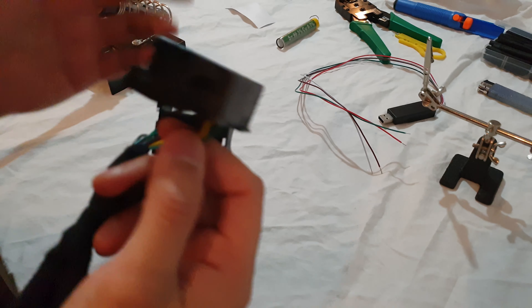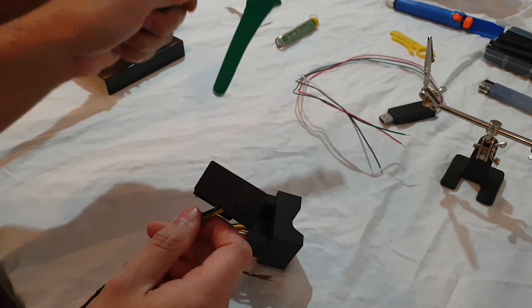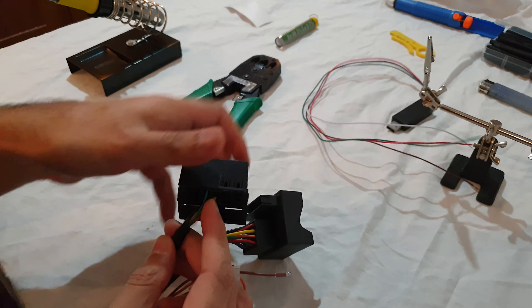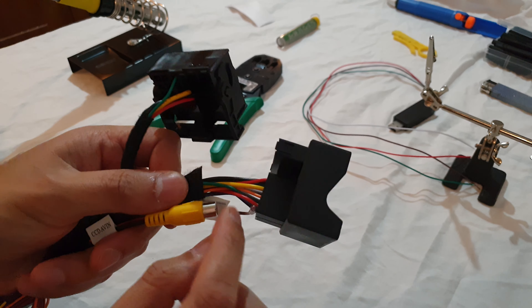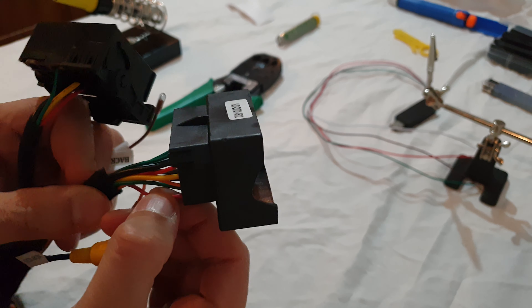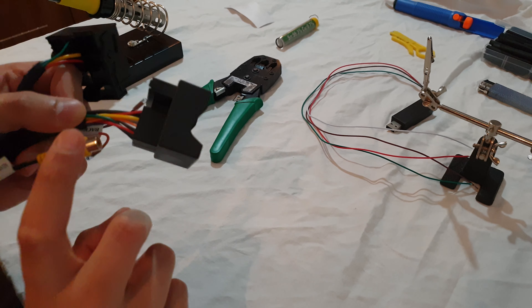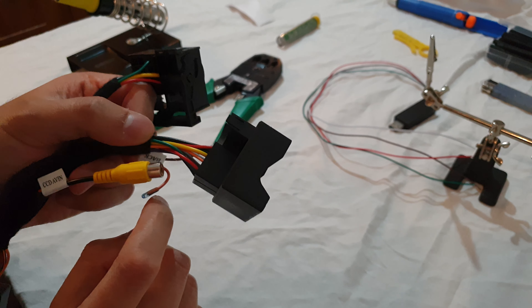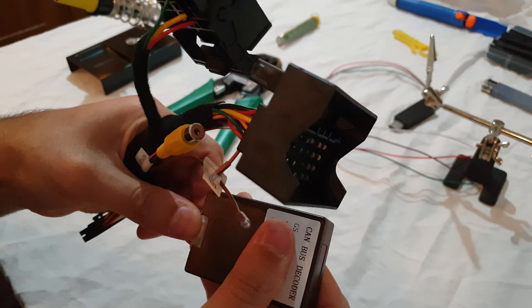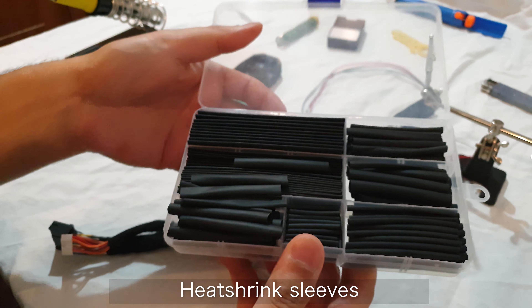This is the harness for my car - it's a 14-pin harness and it's got this extra one with four pins which we can't plug into, so it's no use to me. What I'll be doing is cutting this adapter off to give me more space behind the head unit. The connections here have red for ignition which we don't need, yellow for 12 volts power, green for iBus, and black for ground.